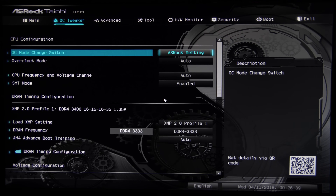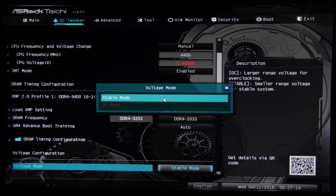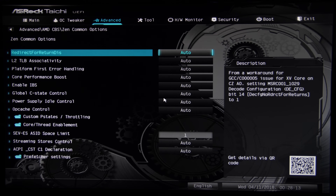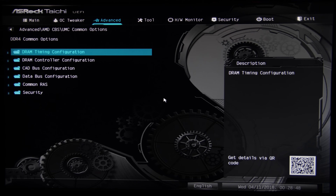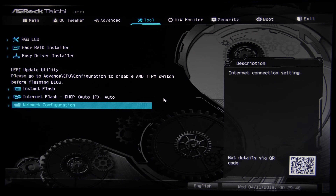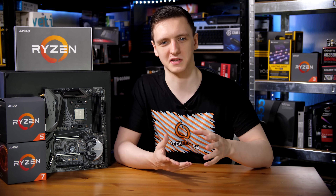Let's take a look at the BIOS. This one is kind of a mix between the more standard original-looking Gigabyte BIOSes and the more user-friendly ASUS and MSI BIOSes, and it sits quite nicely in the middle. It has a pretty easy user interface with a few settings that are somewhat buried. When you're going through the more detailed AMD CBS settings and custom P-states, you have to accept that you could be damaging your chip and that it's not ASRock's fault. The wording changes between 'I agree,' 'I accept,' 'accepted,' which is a little funny, but either way it's still a decent BIOS.